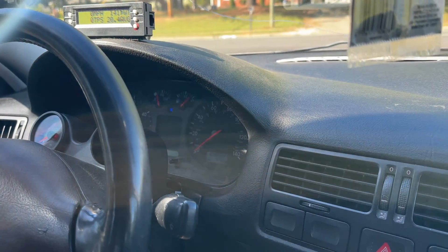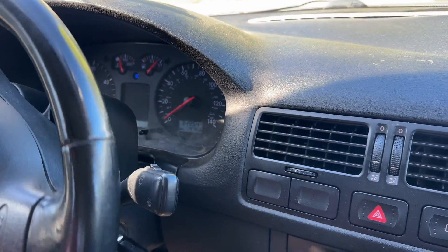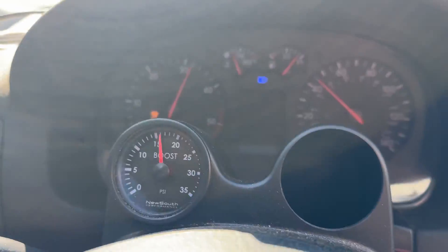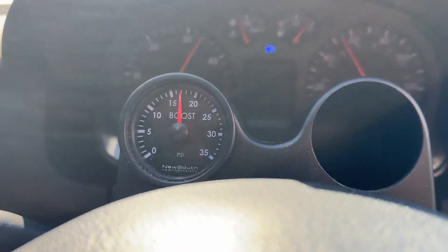We're going to do a little second-gear pull here and see how the boost pressure is. Look at that — beautiful! Five minutes later. Before the cleaning we were boosting about 30 psi and it was kind of staying up there in the 25 psi range. Now you can see it's boosting to about 20-25 psi initial spike, which is normal, and then settling at about 15 psi, which is exactly what we want. That's all we have for this video — see you guys next time.